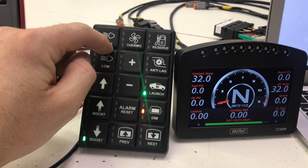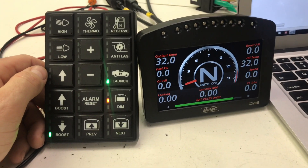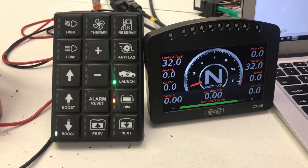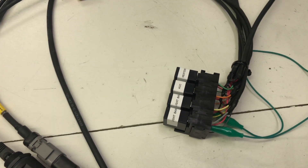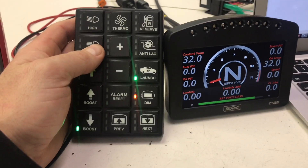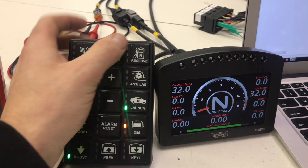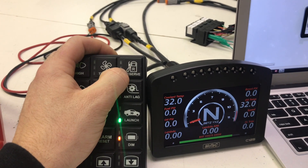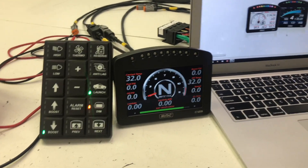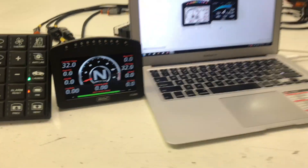Our customer Mike decided he wanted to run some of his light bars on his side-by-side through the MoTeC. Some people think you have to have a PDM to do that, but it's as simple as building out a four-block relay like this and then unlocking the input and output feature in the dash. We've got something that'll run one light bar here, the top light bar on the roof, a heater in his side-by-side, and a reserve pump that he can transfer into the main fuel tank to go long distances. This system's pretty versatile — he uses it in the dunes, the desert, backwoods, everything.